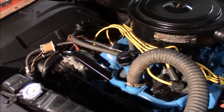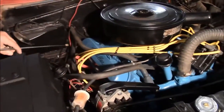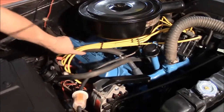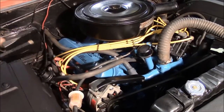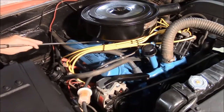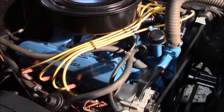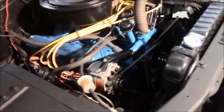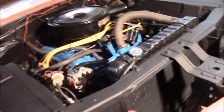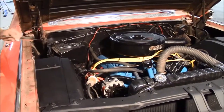And then you'll see on this side, harder to see, the same idea with the Cadillac script. You can see underneath the heater hose and the wires, we have just a subtle feature of the Cadillac, and you can see how clean the intake and so on is. All the gaskets and so on have been replaced. You can see it's the upgraded cork gaskets, which we don't like to paint over top. We like to paint the item separately. And then the exhaust manifold has been repainted with the correct high heat paint.